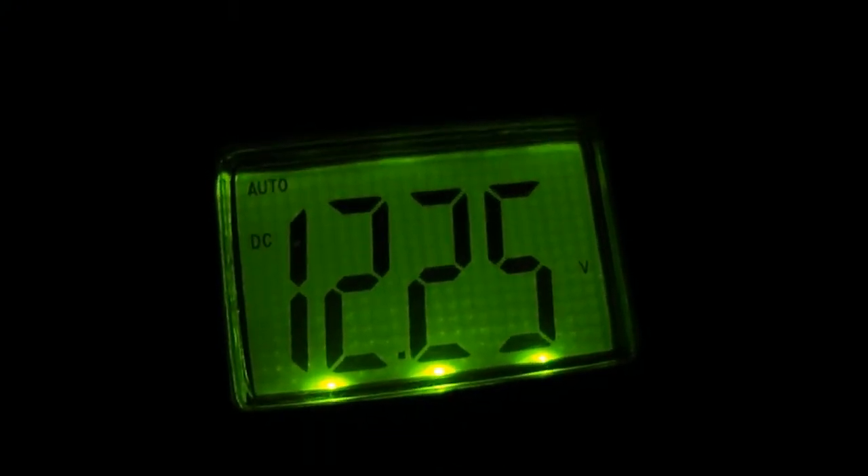I'm going to do a simple load test on my car. I have a voltmeter plugged into the dash on DC volts and for some reason it's giving me 12.2. I don't know if it's just all the resistance in the cables or what. I should check the voltage straight at the battery for a more accurate reading. I'm going to do an alternator test just in case it has a problem — it's a very simple load test and you don't even need any tools besides a voltmeter.